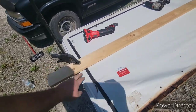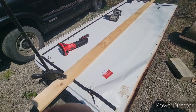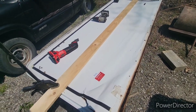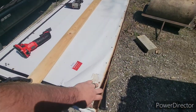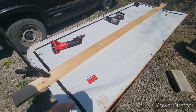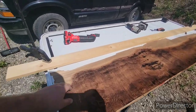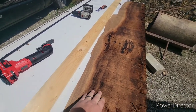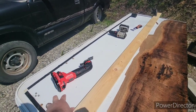I made a cut down the edge, measured back 15 inches on both sides, clamped a board down and used it as a straight edge. I took a utility knife and cut across the edge of it, made a score mark so I can pull the vinyl off to that line. Then I'll go back and use the same board as a guide for the oscillating tool to cut the wood, then remove all the rest of that material. I got a couple inches past where all the wet wood was — the main thing I wanted to do, like I did on the front.